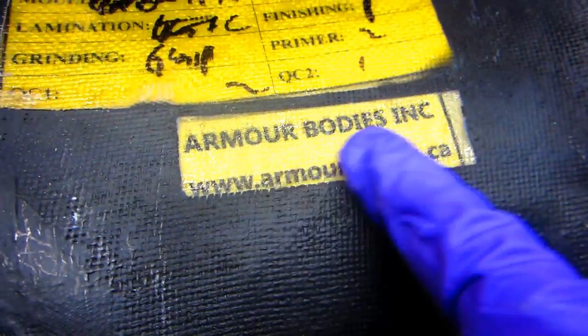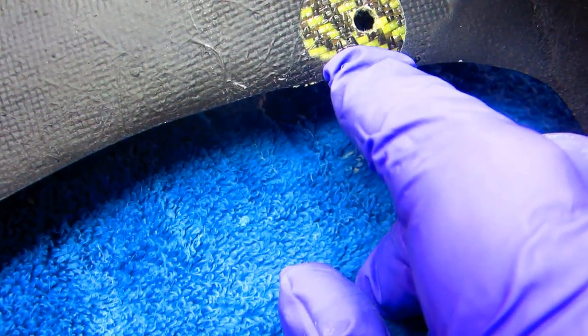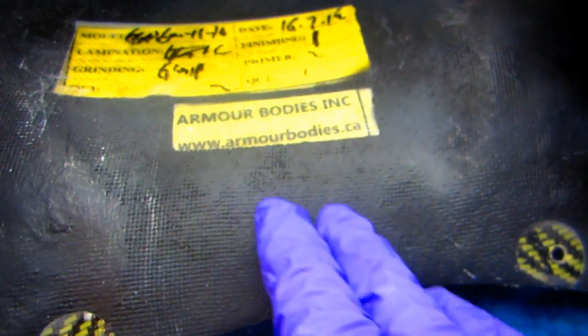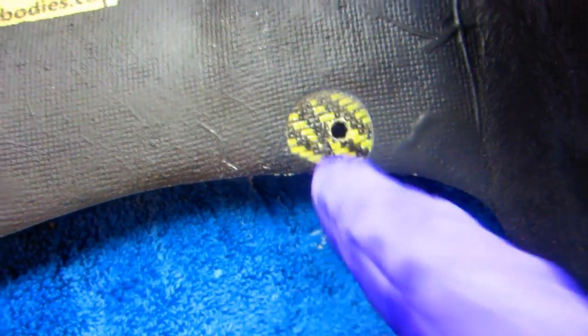Now as a point of reference, this is the seat, and this is just information you may find interesting. When they make these parts, and I want to again say, these really look like nice quality parts. This material looks like a different material. This is herringbone, and it's half Kevlar and half carbon. We have this material in the house, and I'll show it in a minute. But this material, of course this is the first time I've dealt with it. It's very thin. It looks like it's really well made. That's the other part of this. And I need to at some point just sand through here and see if this is carbon, e-glass, or if it's this half Kevlar material.